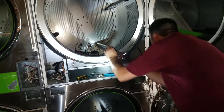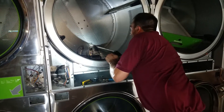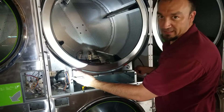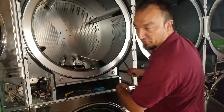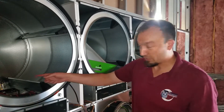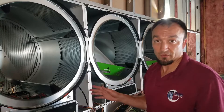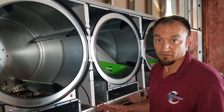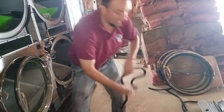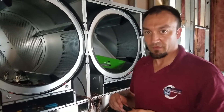Once you cut the connector head, it'll slide back over in between the dryer. So now that those are removed, it's very easy to run just like you did with the old machines — just in through between the drums, right back past here. I recommend ordering the 115-inch wire for the left side because it gives you plenty of length. And that's the power wire. After that, go ahead and get some tubing, because the holes that had the old tubing are pretty sharp, so you don't want that rubbing and cutting. Just cut a little piece, stick them in the holes around the wire, and you're ready to go.